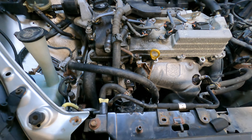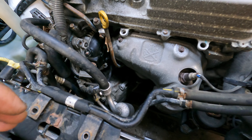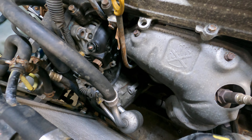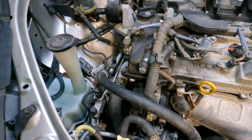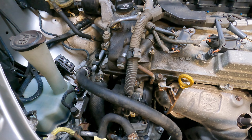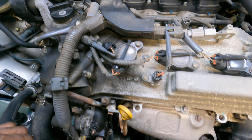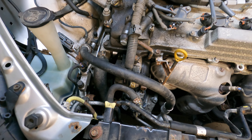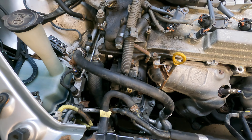We did have to remove the fan assembly. We had to remove the top section of the radiator support, the panel here. We removed the hood latch and the two horns that were mounted underneath this covering here. Those fell down there and were caught by the shroud underneath the vehicle. And now we're in the process of removing the alternator.